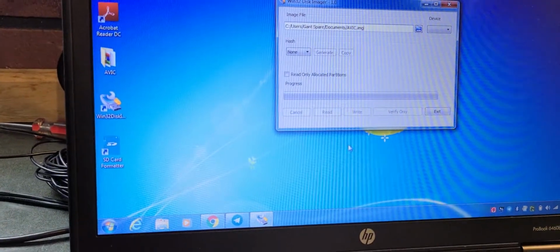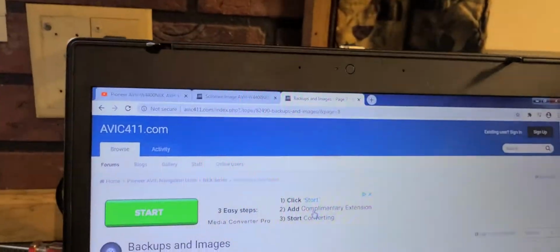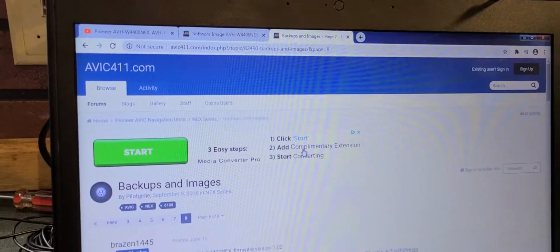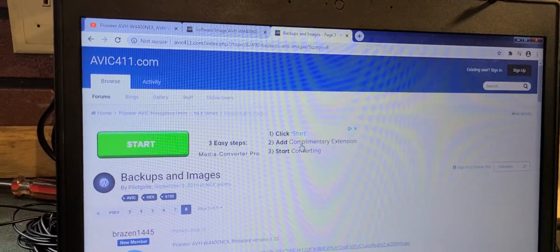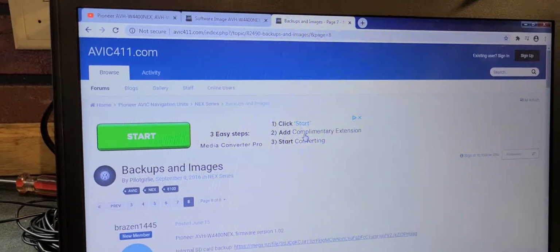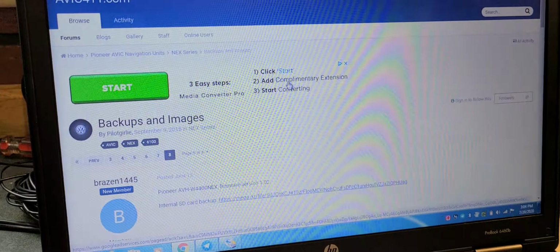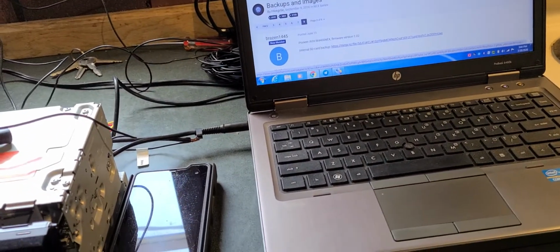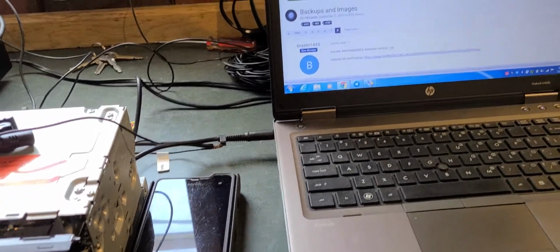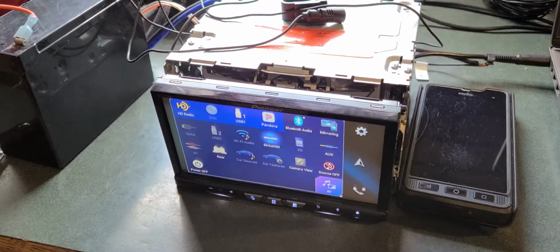And again, like I said, this isn't anything that's a secret. I don't know why nobody's posted a video on this. This is pretty much public knowledge. You'll have to join this forum. It's free. It didn't cost me anything to download that file there. Just go to avic411.com, search for that model number, go to the last page. If you're in a boot loop, write you a card, make sure it's a 16 gigabyte. And as usual, always format it to FAT32 when you format that card, and do it the long way to make sure it's right, and then write your image to it.